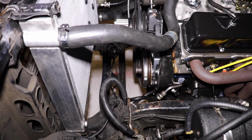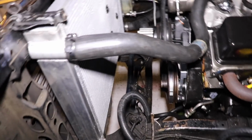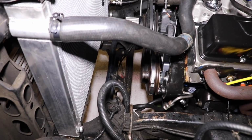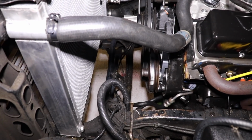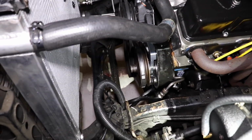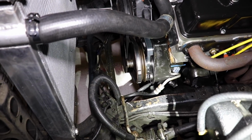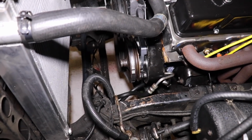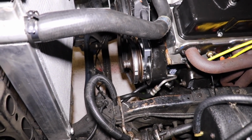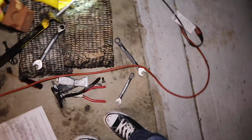I think it's when you hear that sound, that noise, that's when it's actually stopping. I don't know if you want to rewind the video and see, or stand out here while it's cranked and look. Yeah, that's fine. The real big issue is the belt's just not tight enough. That's probably why the pulley's stopping. It's because of the belt being movable.